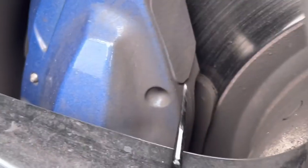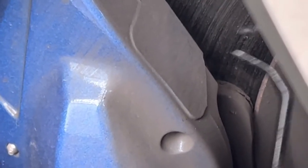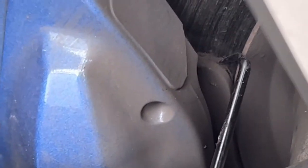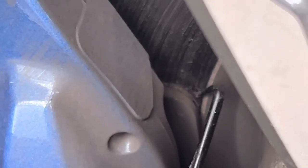Now I'm going to the rear brake pad. See it — this is the rear brake pad. This is the metal bit, this is the disc. In between the disc and the metal pad you can see the pad section. This one is also low. When I compare with the front brake pad, it's not as low, but however it's still low.